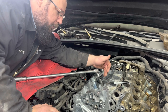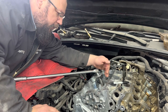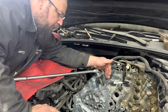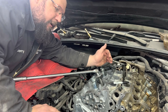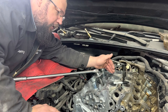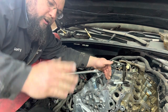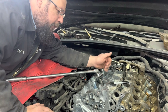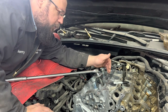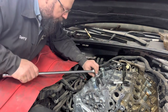Some people want to put a mark on the head of the bolt — I just put it on the land of the valve cover. It's shiny right there, you can see it real easy. Put a mark there, because you never know when somebody's going to come in the door, or the phone's going to ring, or you'll get a notification on your YouTube channel — anything that'll disturb you in the middle of what you're doing. Don't rely on your memory as to which one you did.